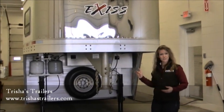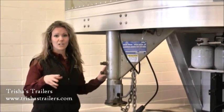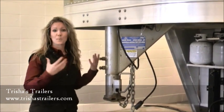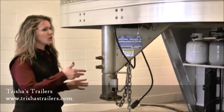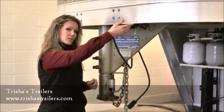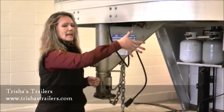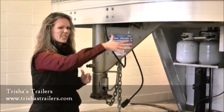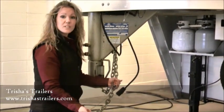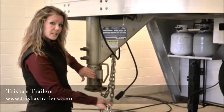We're going to do the exterior first and then the interior. This is your gooseneck stem, which on most trailers will be completely adjustable. You're going to loosen these bolts and then you can slide it up and down to the proper position. You want about six inches, or a man's hand span of clearance between the bottom rail of this nose and the top rail of your pickup bed, so that way you're not crunching anything. You've also got separate safety chains — you want to crisscross these so they'll cradle this coupler if you become disconnected.